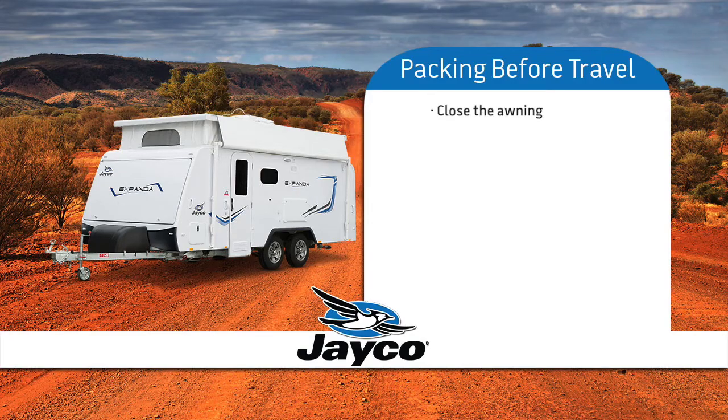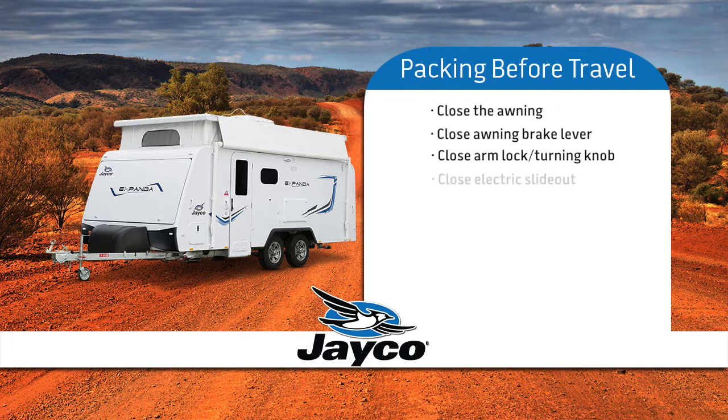Close the awning. Check that the brake lever of the awning is in the closed position, as well as the arm storage lock, and that the turning knob is tight. Close the electric slide out. Turn off the gas. Wind the rear jacks up.